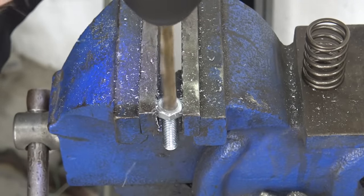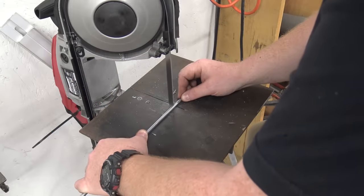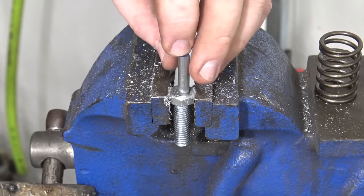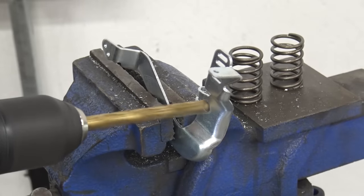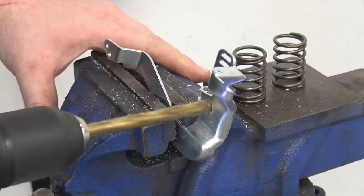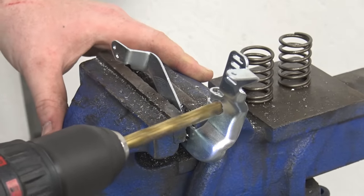To use the stock throttle assembly I have taken a 3/8 bolt and bored a pit in the top. Then I cut a small piece of rod stock and weld it to the top of the bolt. The bolt will then thread into the tapped governor hole and be used as a pivot point for my throttle. I use a brass bushing so parts won't bind.